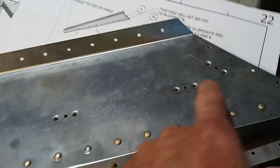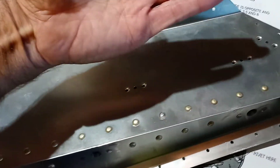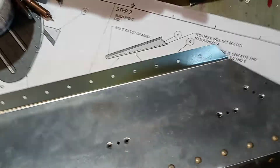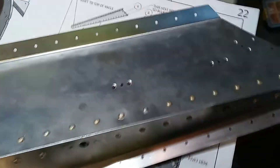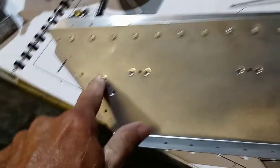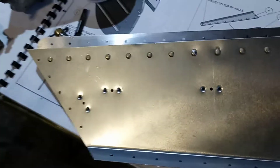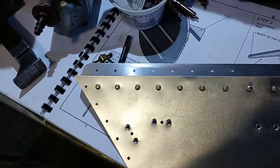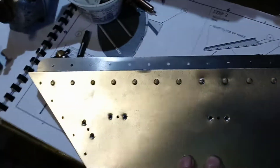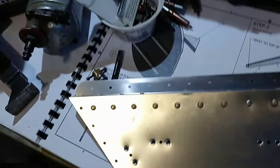Here is what they're talking about, but they don't come countersunk — I don't know that it needs it or not. What this is is an air baffle that goes right underneath the engine to control air going underneath it. The bottom of the engine has fins on there, which is also the oil pan, and that forces air across the bottom of the oil pan to help in the cooling of the engine.